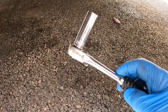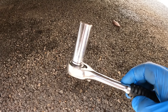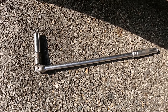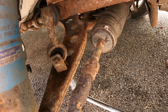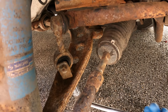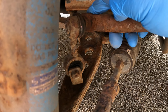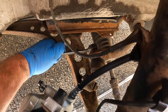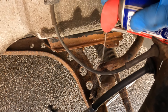It's incredibly tight — using a ratchet and a 16mm socket was not shifting it so I'm going to have to get a bar on this for additional leverage. But as this is fighting me and I don't need to save any of those components, I may as well just undo this drop link at the anti-roll bar. This is a 16mm nut — a bit of WD on the threads makes things a little easier.